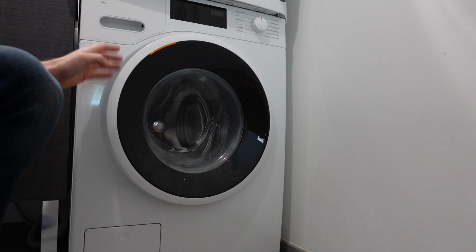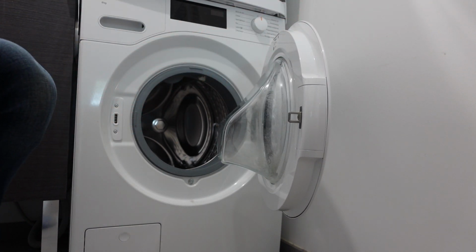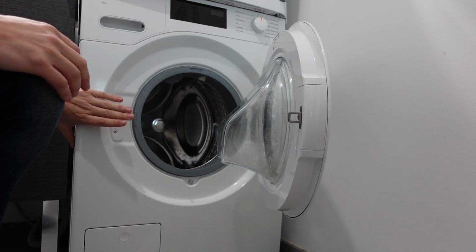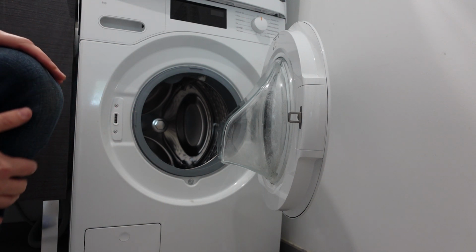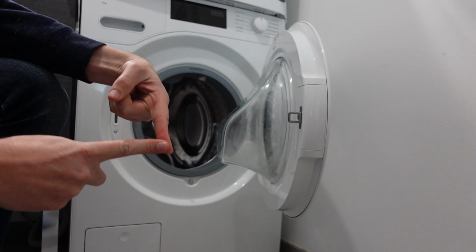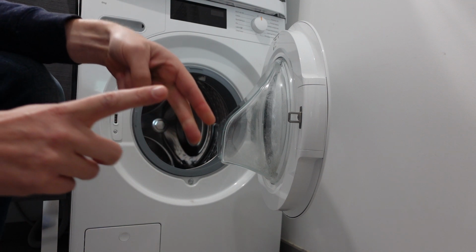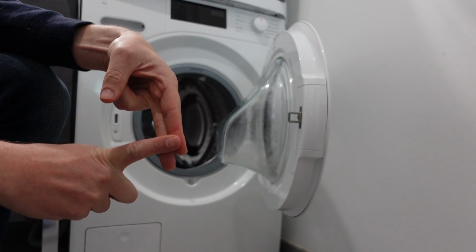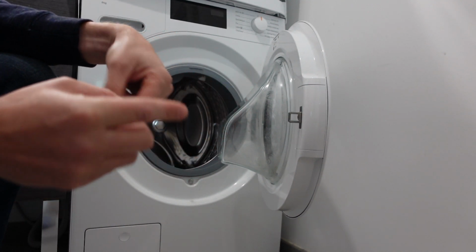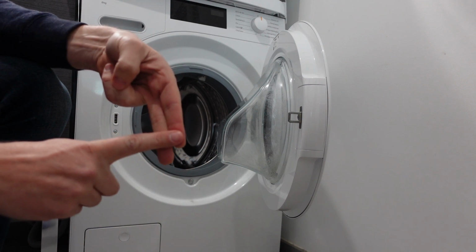So how can you get rid of this error? The main thing you want to check is the electricity that's going to the machine, but not actually the machine itself. This can be things like you are using an extension cord that is not heavy duty enough to carry the voltage necessary. This could be, in some rare instances, like you bought the machine in one country and you're using it in another country, so that the electricity that it's getting is not what it thinks it's supposed to be getting because of different protocols in different countries.